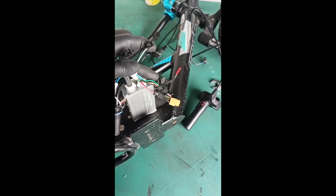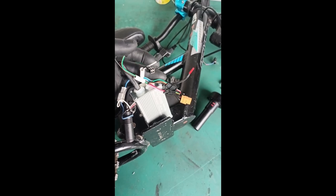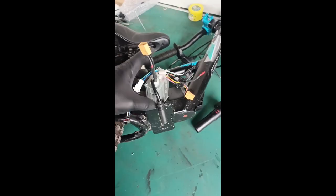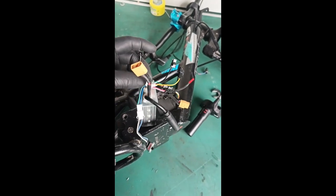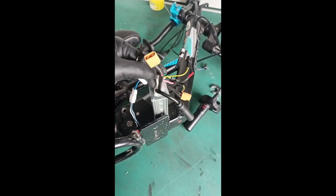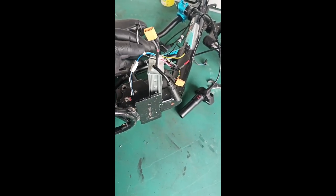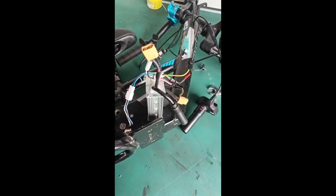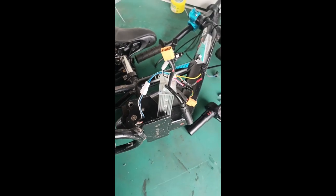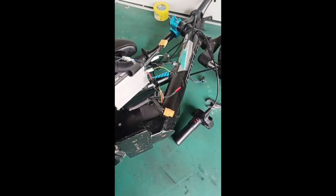The white and black wire is the 50% power mode on the R controller. If your child is proficient and the only one riding the bike, you can leave it unplugged or cut it right off. But do not do that until you have ridden the bike and made sure your child can handle the speed.